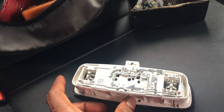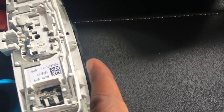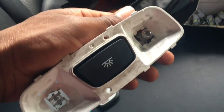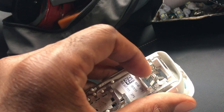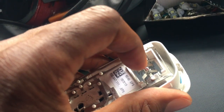Once you have the light unit out, you can see there are four tabs on the back. You just want to use your fingernail to push it forward — push this black bit forward to allow it to pop out. Do that all the way across and on the other side, and it should come out. Be very, very gentle. Once you've taken that black part out, you'll have easy access to pull the bulbs out. If you're struggling because you've got chubby fingers, just push from the top, being very careful where the bulb drops so it doesn't crack.